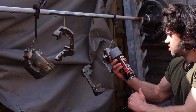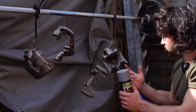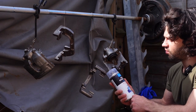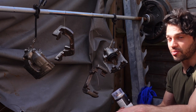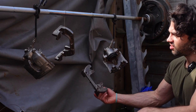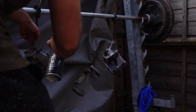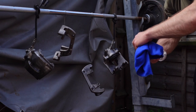The products I'm using: a primer rated for 700 to 1000 degrees — the brake calipers won't reach that temperature as this is not a racing car. Then a red paint that should be the closest match to BMW red. Finally, a heat-resistant lacquer clear coat — the most important thing is that it resists the chemicals put on the road in winter months. I'm also using isopropyl alcohol in the prep.